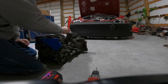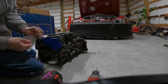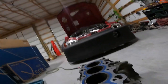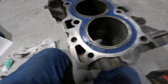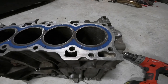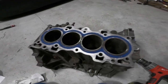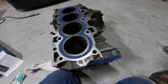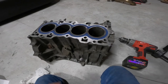Just finishing up wiping around the holes after drilling it out. Per the instructions I went with 3/32nds to drill out everything, but when I got done, 3/32nds felt pretty small — even 5/32nds is quite a bit smaller than the hole in the head gasket for water flow. In the area we live, I really didn't feel we'd get enough water flow at something that small, so I chose 5/32nds. That should not have screwed with the integrity or structural strength of it. The only thing left is to take this thing to the machine shop — they're going to give it a nice deck.